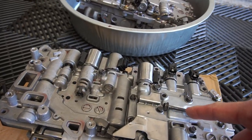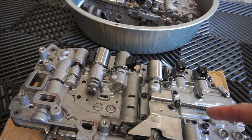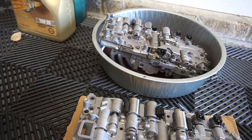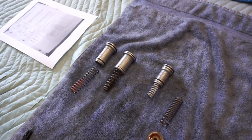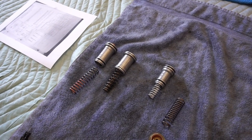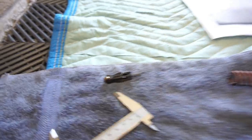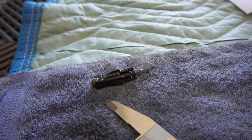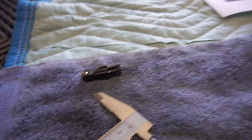This long bolt is going to be needed once I'm able to push this thing up under the car and up inside the transmission. All the other bolts I left where they belong in the old one, so I can slide that over. I can pretty much guarantee yours are going to fall out because you're going to probably be doing this under the car, which is quite the pain. This here is the check valve, and that's the thing you really want to be careful about because the spring is really light — you lose that and you're in trouble.